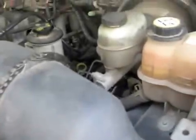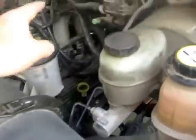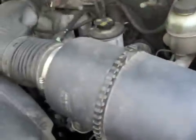I would also start with a pressure test. I'd pressure test every vehicle with an overheating complaint, because I've been fooled many times thinking it was a radiator or thermostat problem when there was a small hose way at the back of the engine that was just barely leaking — but that caused the overheating, and the pressure test would rule that out.